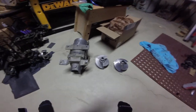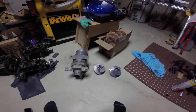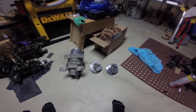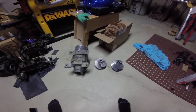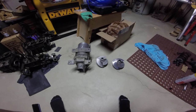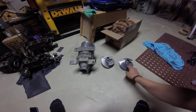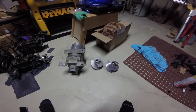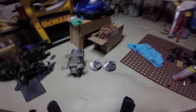Now, there's also impellers that are, let's say, like 13/17, with a slash in the middle. I don't really use them, so I don't know exactly, but that means it's a tapered pitch. So that's the Solas impellers, however you pronounce that. Those are the impellers that have different pitches on the impeller. This is called the straight pitch impeller, Scat Track straight pitch. And then the Solas ones have a stepped pitch. So that's kind of the deal with impeller pitch.